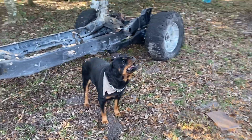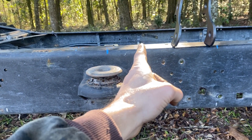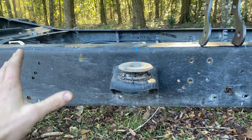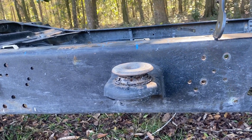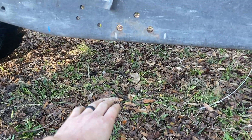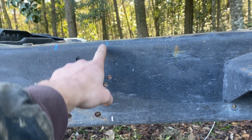The wheelbase of this truck is six and a half inches longer than the blue crew cab, so I'm going to z-notch the frame. This center cab mount gets cut off, we cut the frame and take out six and a half inches, slide it forward, re-weld it, and the cradle will act as a fish plate over the top. It'll be 32 inches wide at the mounts and hang down four inches below the frame — nothing hanging super low.